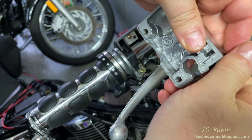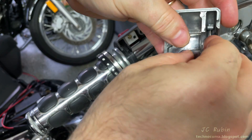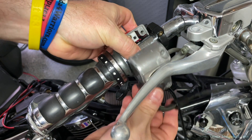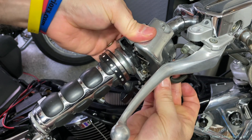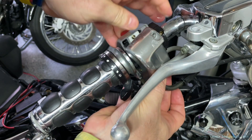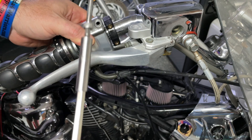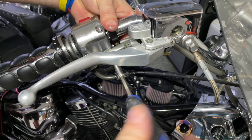I hand-tighten the flat-head screw for now and will revisit with a screwdriver later. I pull the cable slack out to work with it, bring it around and up top so I can see it into the grip. Bringing both shells together, I still have to get that electrical cable around the notch on the bottom and press it in so it snaps into the notch. Making sure nothing is pinched, I hold the shells together — done. A gentle throttle-turning test can be done, but make sure not to bend the cables. Here are the new screws from Ace with anti-seize — installing those now, just snug, because we'll have to come back and adjust everything once the bike is fully assembled.